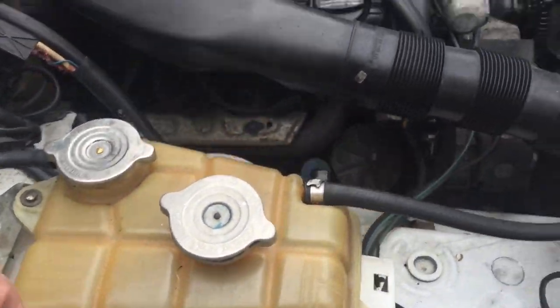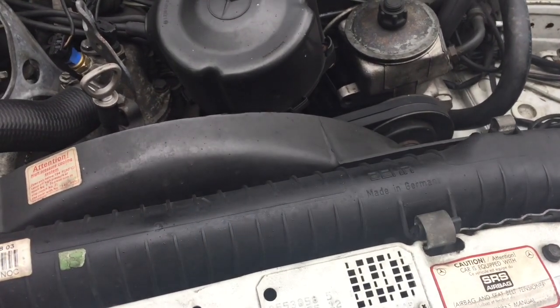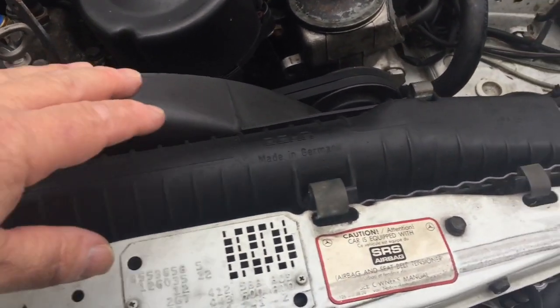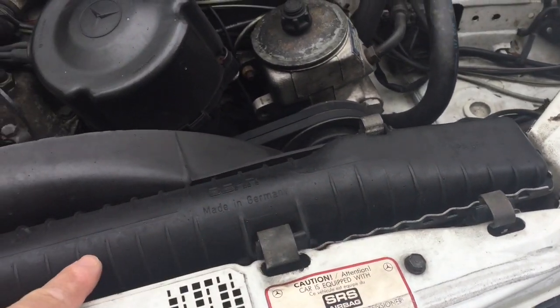What can happen if you don't do it right? On these old plastic radiator coolers, after 30 years that plastic gets pretty brittle, and if you get a cooler cap that has too high a pressure on it, they start leaking right there. I had one where the plastic split right open up here or down at the bottom. Make sure that technically the cooler cap is the right one, and then try to figure out how to save money. Go for the technical solution first and then look at the money.